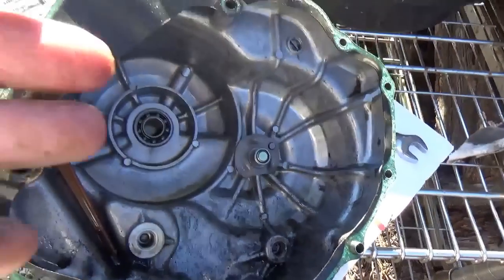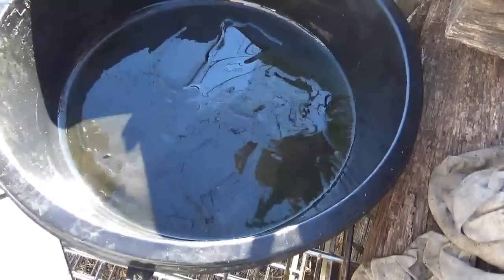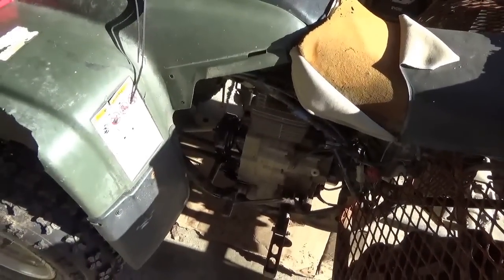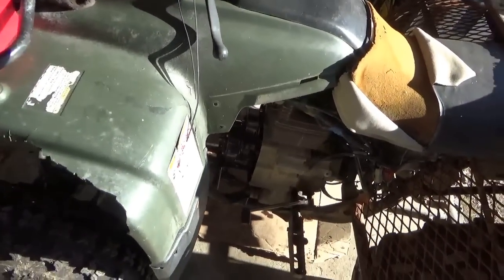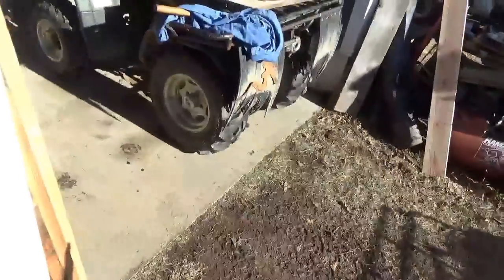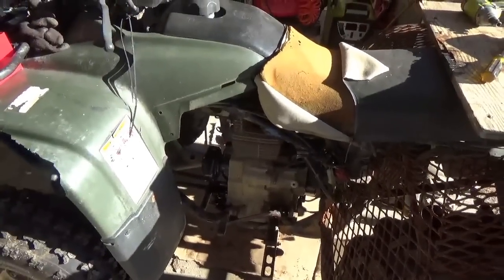That's been replaced and I made sure it's not seized up and it's able to move - all good. I very carefully drained the oil into that container and I just wanted to make sure there were no more thrust washers or case-protecting washers missing. I also like to look at the bits and pieces in the oil to see if anything is falling apart in there, and it really looked pretty nice and clean - that's all good news. Some of you may ask what's in there - that's some solvent I used to rinse this out, and you really don't want it on the ground.